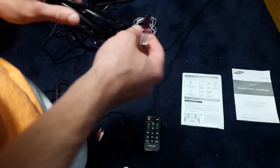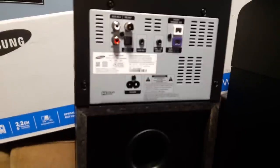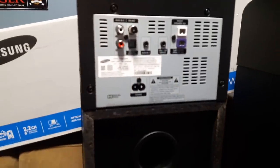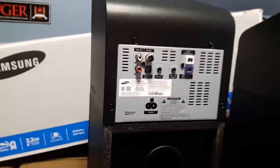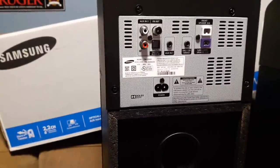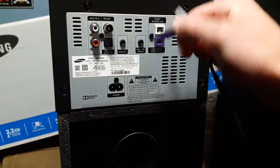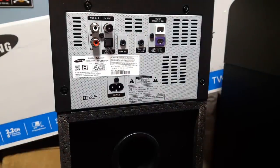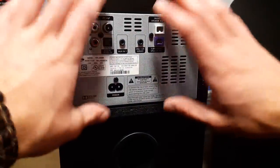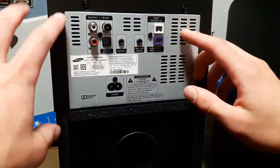That way you have the audio going - let me adjust the camera so you can see. As you can see, you've got all of these connections. This cable comes from the other sound tower and gets plugged in here and here - one for the speaker, one for the subwoofer - because your inputs from your TV, receiver, or whatever they go into this one. Then those plugs go here, and that information gets sent to the other sound tower. So this is the sound tower you connect your main stuff to.